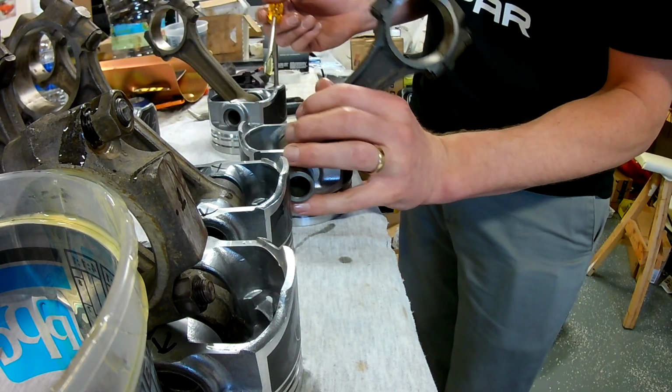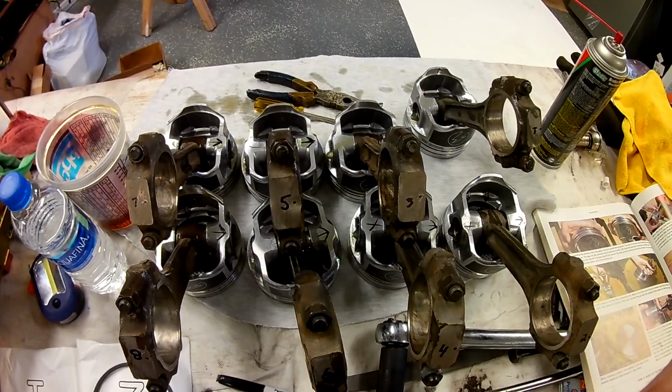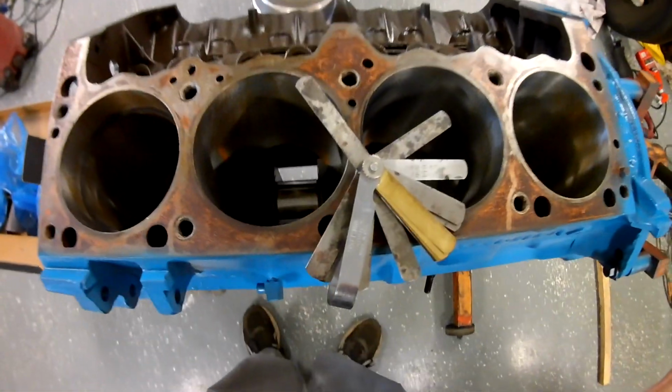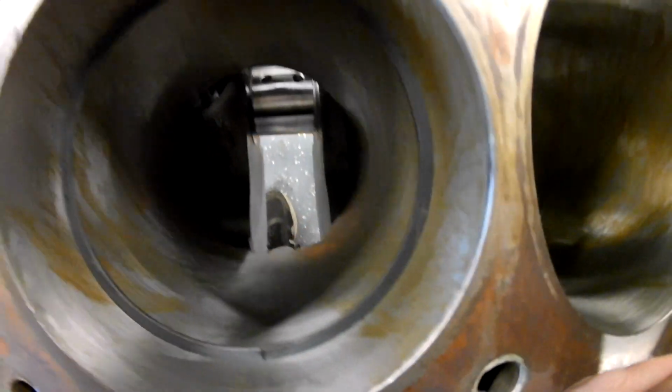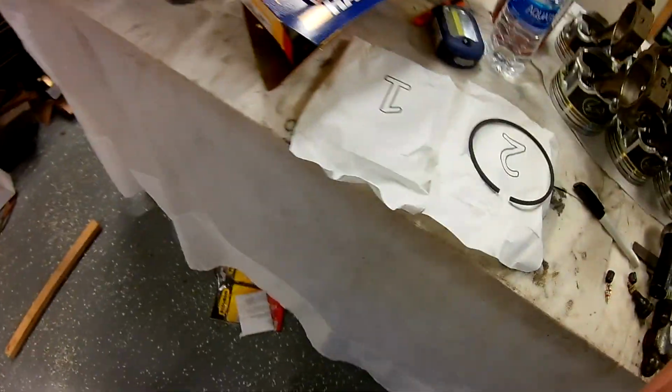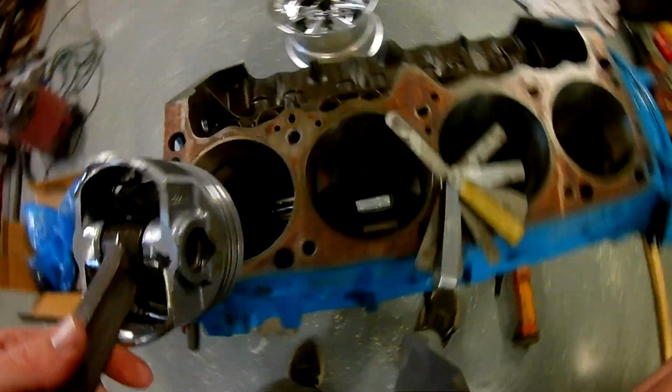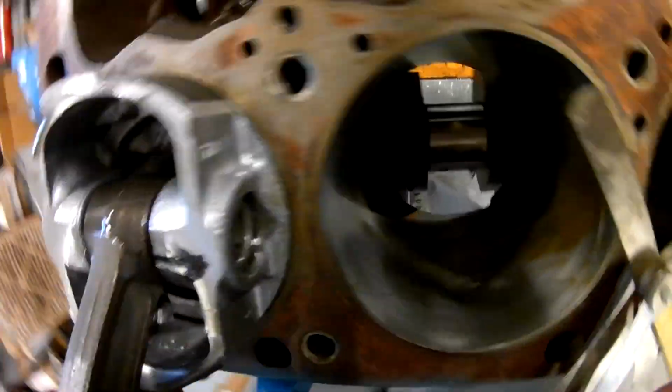That there. Got my wrist pin stuck in, and you think, let's go ahead and throw that motor together. Well, we got to check all of our ring gaps, and here's how you do that. This is the top compression ring. Always follow the sheet, whatever the sheet says. My top ring, my number 1, does not have a dot on it or any mark. So I've looked both sides, a dot or a laser mark. I've looked for a bevel. There's no bevel. So I went ahead and stuck her down in there a couple inches and just used my new piston. Stuck it like that and got it. I usually go down to where the skirt starts, or something that's pretty dead on for depth.